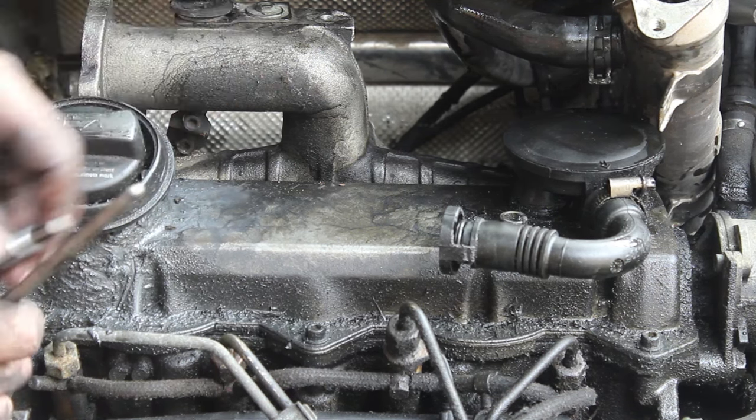All right, we have the intake manifold off, and you can see that the gunk is all the way down into the bottom, clogging up the runners here, having a hard time getting my index finger in there. So now comes the fun part. We're going to soak this in diesel or kerosene or gasoline, just some kind of fuel of that type for a little bit to break it all loose, and then we're going to burn the ever-loving piss out of it. While you are here, it would be a good idea to make sure that your turbo vanes are actuating fine.